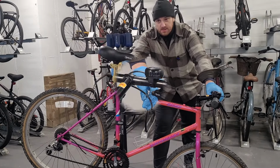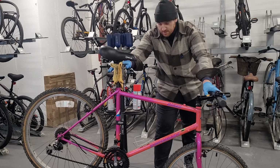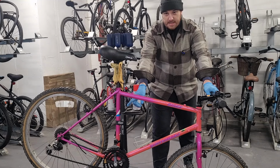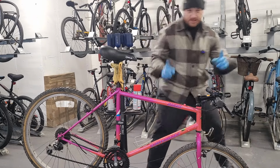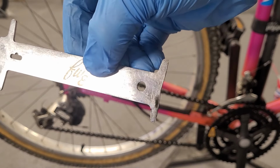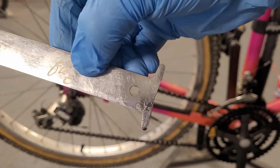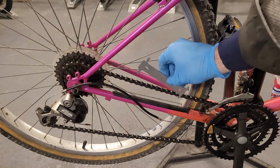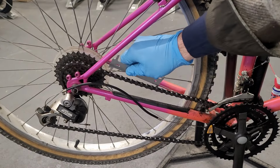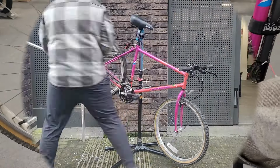Okay, I've just done some thinking with my brew, and I'm just going to wash the bike, that chain, and actually I'm going to double check that it is not worn out. Let's get you to see that. So that's the wear, 0.75. And when we put it on the chain, that's pretty good. And then you check a few links, check underneath if you can see.